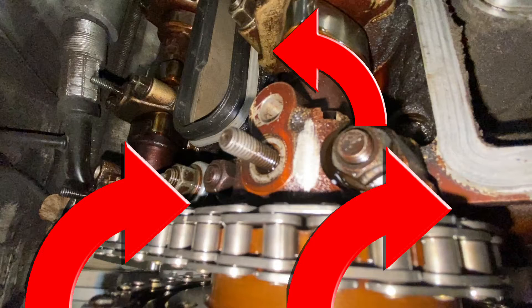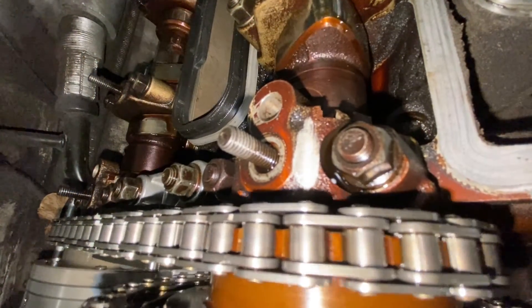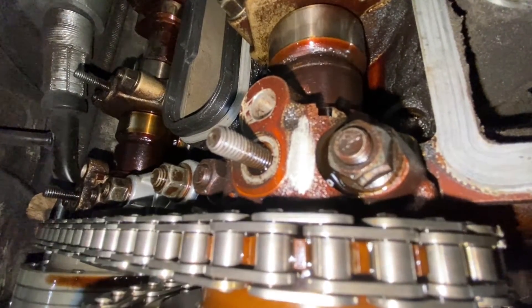The camshafts are lagging behind and they're actually almost staying towards the left side, so your timing is going to go out every time you try to set your timing at TDC. You won't get the slots to line up as you can see in the diagram. The reason for that is those springs I've just shown you — they're just too weak and they don't keep enough positive pressure, so they don't key the camshafts to the Vanos sprockets enough.